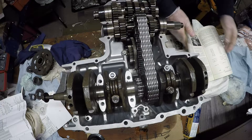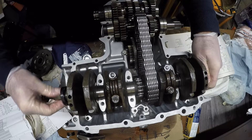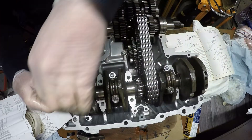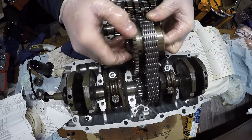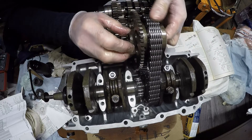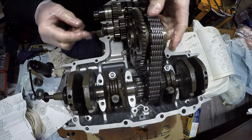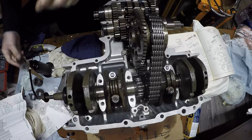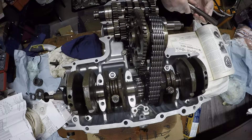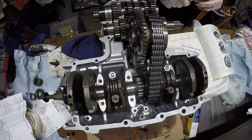You should keep referring back to the manual, which I did a lot - I forgot to put the oil seals on. Quick fiddle, got them in position. The next task is to get the starter clutch in place. This just sits here until you put the top case on and put the shaft through it. If this primary drive chain is not sat on the crankshaft teeth correctly, there's no way on earth you can push this through the crankcase bearing and the starter clutch.